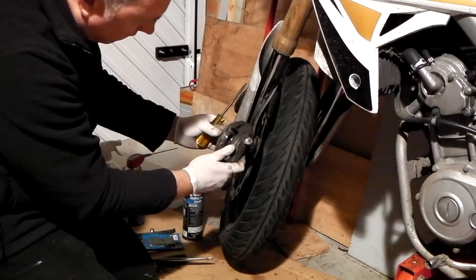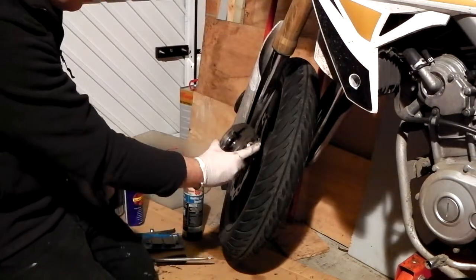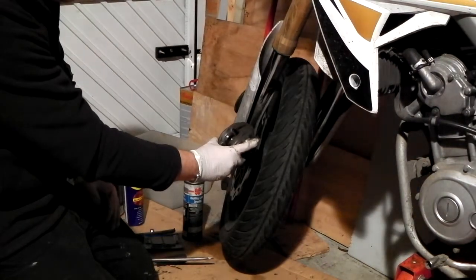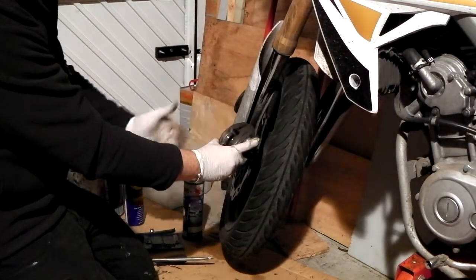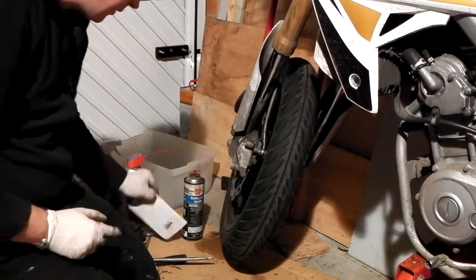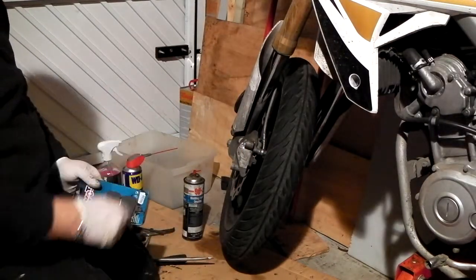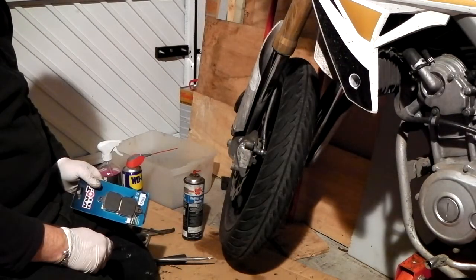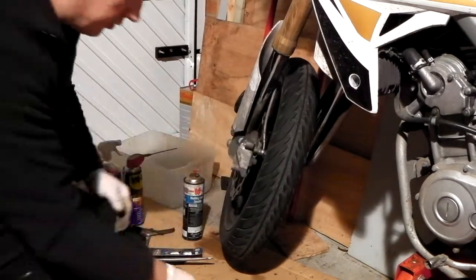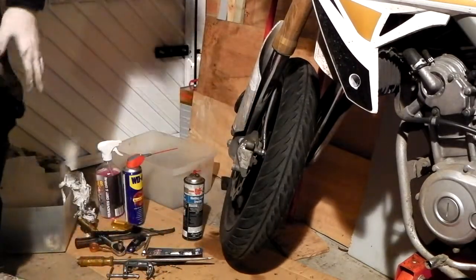Right, that's perfect, that's really good. I'm really pleased with that. There's no corrosion on these pistons at all. So what I'm going to do is push this piston back, rebuild the caliper with a fresh pair of brake pads, and then change the fluid, which I'll film to show you. Putting these pads back in is going to be quite tricky because I've got to work out where this clip goes, but see you in a minute.